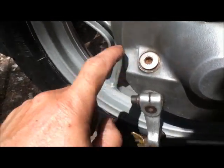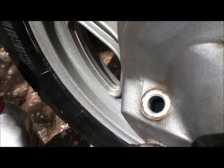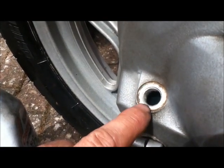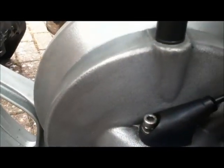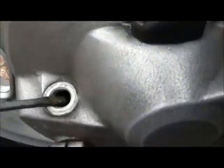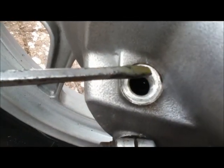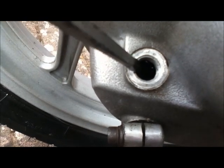While you're at it, you might as well also check the level in the gearbox bevel drive. With the bevel drive there isn't a dipstick - you just check that the oil is up to the bottom thread, and I can just see that's correct. A little tip: if you put a screwdriver in there and bring out a sample of the oil, you can see that's lovely and clean and bright like new oil, so that doesn't need changing.